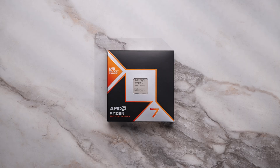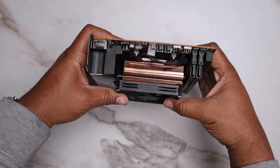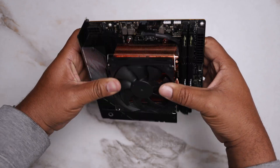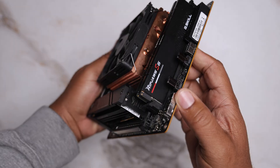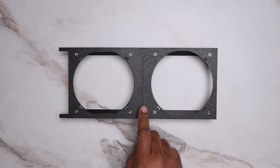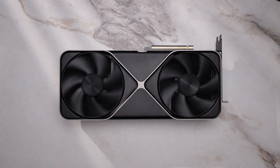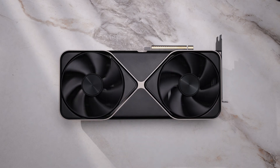For the purpose of this video we'll be testing the standard G2 model. The first setup uses the Ryzen 7 9800X3D inside the Form T1, cooled by the Thermalright AXP90-X53 with the Noctua NF-A9x14 HS as a fan swap. The G1 and G2 fans are tested as top exhaust fans using a 3D-printed shroud from EGA. The GPU is the RTX 5080 Founders Edition in the three-slot configuration, offset using standoffs — a very airflow-sensitive setup.